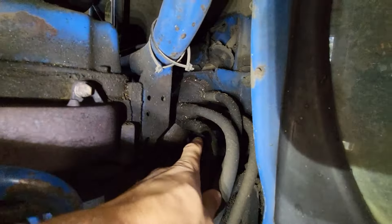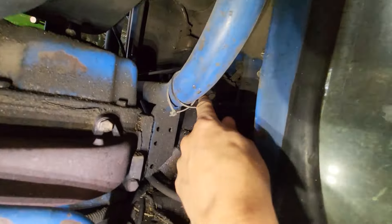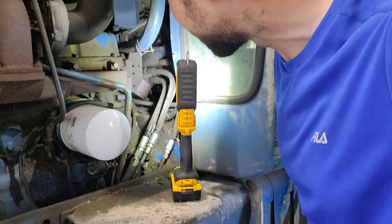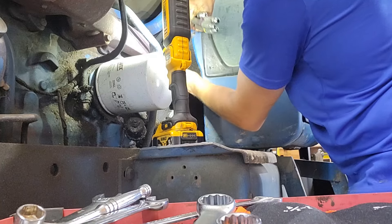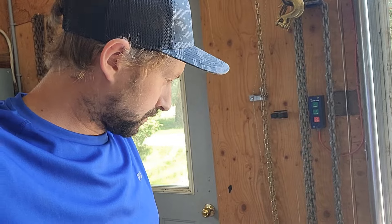For anyone that's new here — the steering pump's in here. We've had it apart way too many times but we'll do it again. Just take these hoses off and unbolt the top. It's actually fairly simple — it's crazy how much more simple it is now that I've done it four times. All the bolts are out, just got it up here — and that's it right there. We'll just set this here and dad can come pick it up and get it fixed, and hopefully they can figure out what is actually going on.